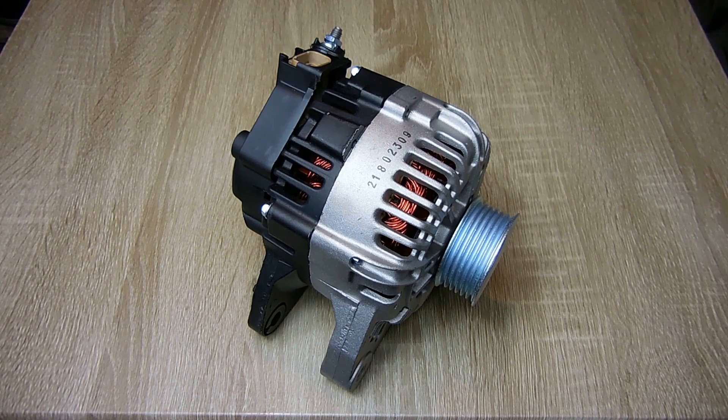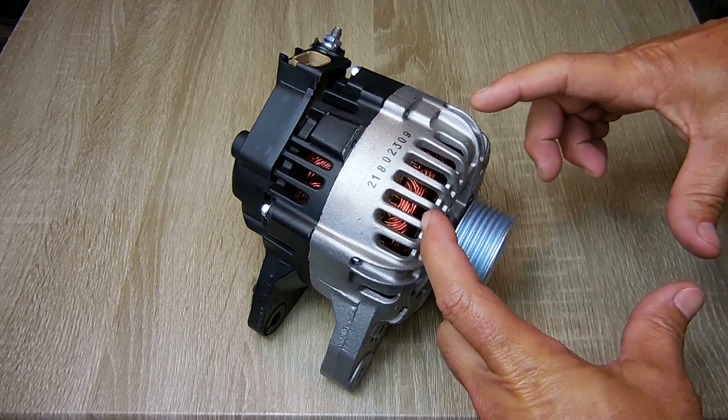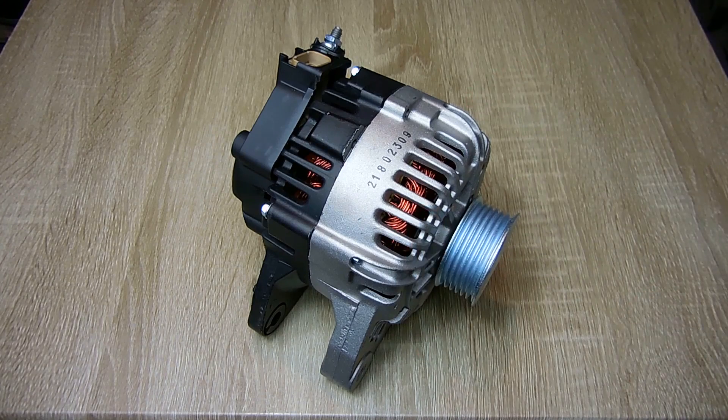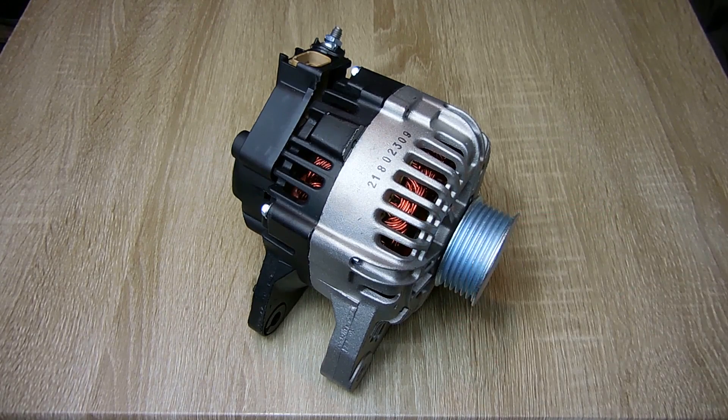If the typical vehicle is idling at 700 RPM, you need this to spin a lot faster while the vehicle is idling. That's why the pulley is much smaller than your crankshaft pulley, which is usually about 6 or 7 inches in diameter. For every one rotation of the crankshaft pulley, this will rotate probably three times — a 3 to 1 ratio. So if idling around 750 RPM, this pulley will be spinning around 2100 to 2200 RPM, giving you a reasonable output to charge your battery while idling.